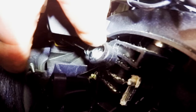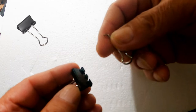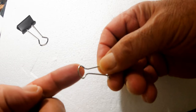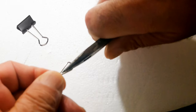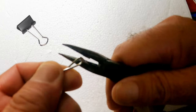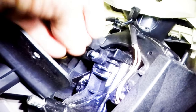We need to get this temporarily fixed and came up with this idea of using a washer and using some kind of clips to lock it into the shaft. By using one of the wires from a small paper clamp, we can insert the eye into the shaft and then tighten it to hold it in. We first put a washer on the shaft to fill the gap.